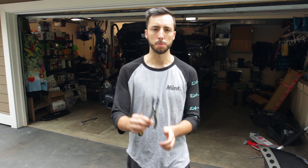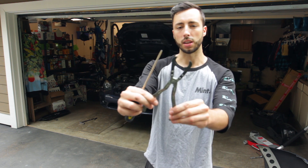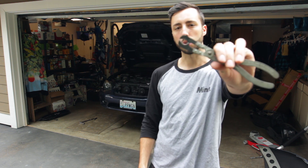With the grille removed from the car, we're ready to start pulling the bumper. The bumper is pretty much attached by poppets that run along the bottom front lip and into the wheel wells. It's pretty simple to pull off, though they can be a little tricky as they've gotten older or stuck. A flat head screwdriver and a pair of pliers that can wrap around the top piece and pull it out work really well.